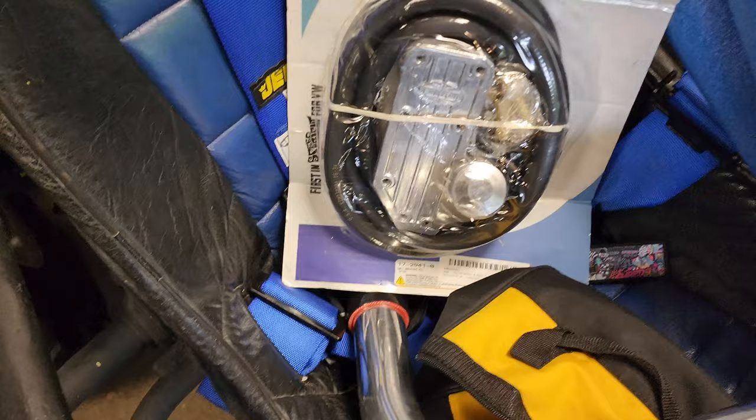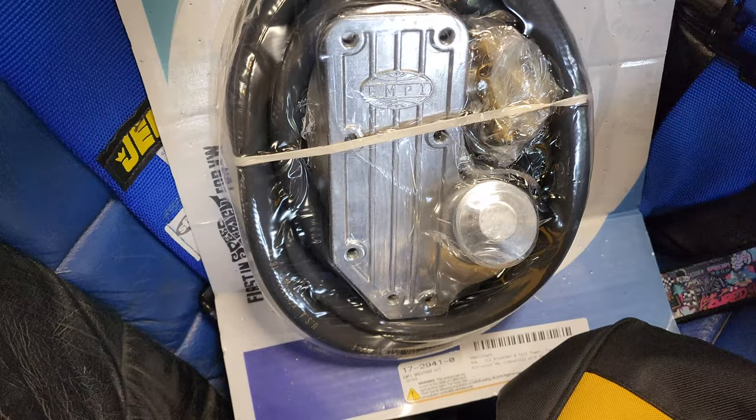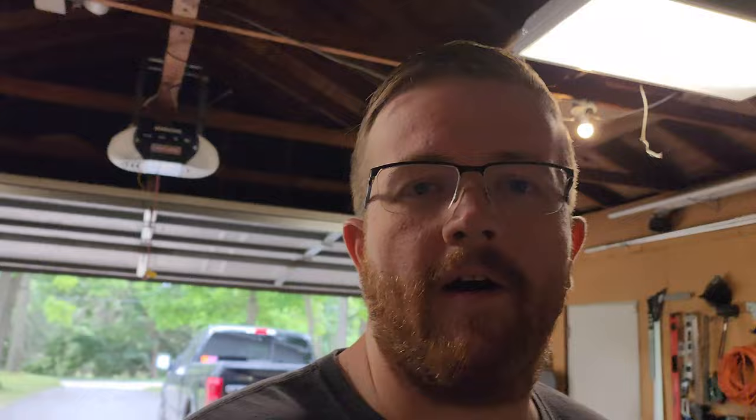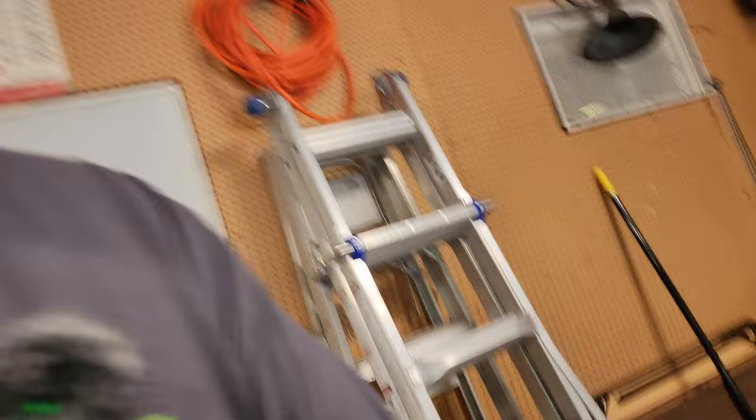I'm going to have a little bit better ventilation than my single vent right now. Going to get this thing torn apart here in just a sec, get it mounted up. It looks like a pretty easy install process. I do have a surprise for another problem solution here that'll be coming shortly as well. My plan currently is to vent one of the bottom vent holes out of that tower into my current catch can, and then have two vents off the top. So in theory, I'm going from one vent to three. Hopefully that makes a bit of a difference and stops pushing quite as much oil out at the crank, because I'm sure that's where it's coming out with the pulley.